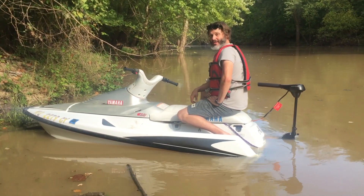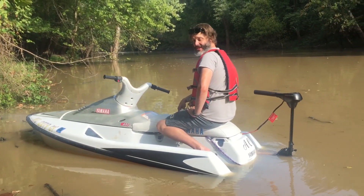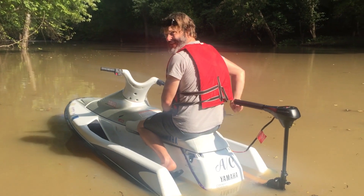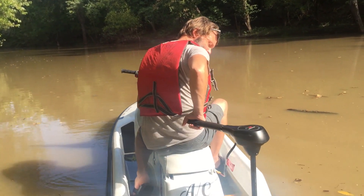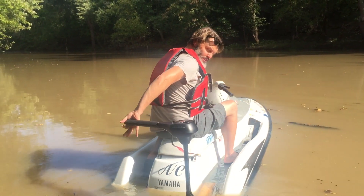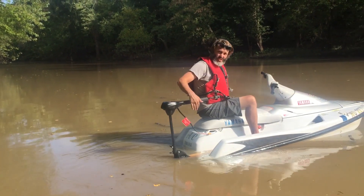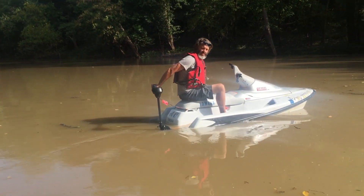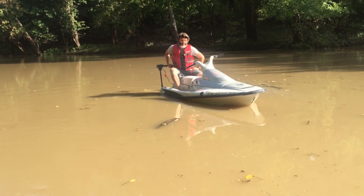I do think I want more speed though. It's a lot peppier on 24 volts. I think I might change out the controller for something with proportional throttle where I'm not getting underneath my seat and changing the knob. Then probably just mount a little thumb throttle right here — that's what I'm thinking. A little thumb throttle right there. Put a little hinge on here, get rid of all the crap inside. Then it will fold nice and tight down here and it won't be in the way. Just what I need — one more project.